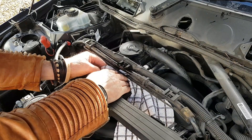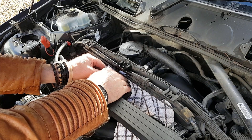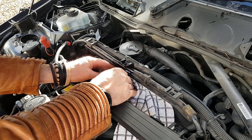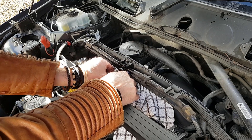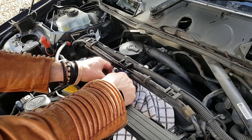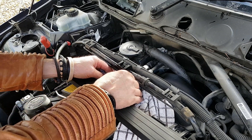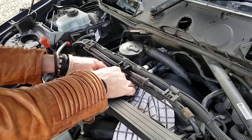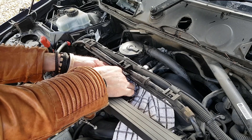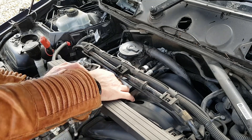There we go - showered with petrol. It's not much coming out but it's a bit of a shock all the same. And of course I've got a fire extinguisher to hand - always do when you're working with a petrol system, especially when the engine's still hot as it is today. Once you let the pressure out, get the rag out of the way and then just unscrew the sensor. It isn't tight in position - it's a brass fitting so you can't put too much pressure on it, it will break something.